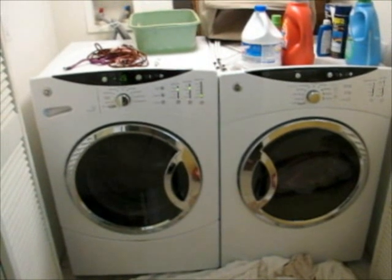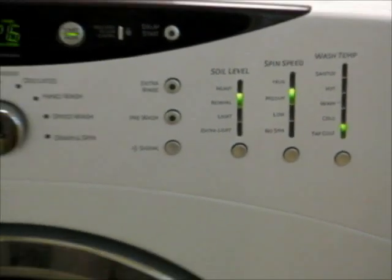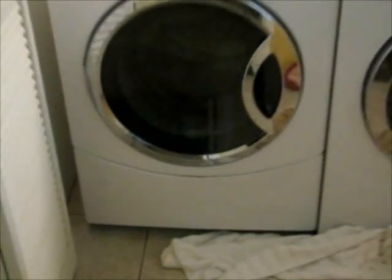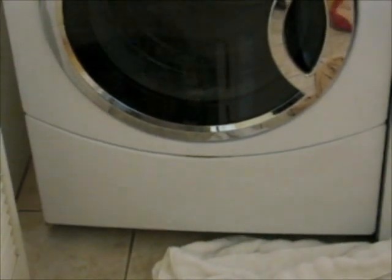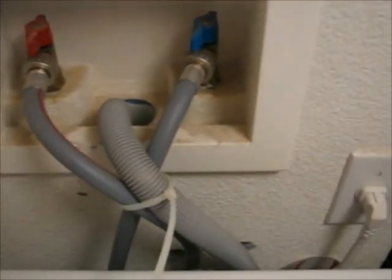Here's our latest incident. What have I tried to do? I tried to modify the GE washer by spinning only on medium. The floor is level, all the legs are snug to the chassis, and rather than the washing machine detecting that this is out of balance, it will continue to rock and shimmy and walk. Maybe before long it'll walk its way back into the wall where it's made these marks. Oh good, it stopped.